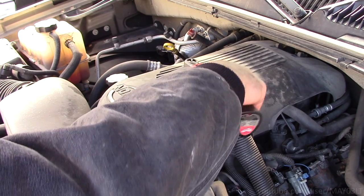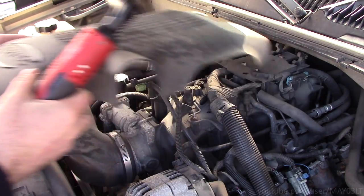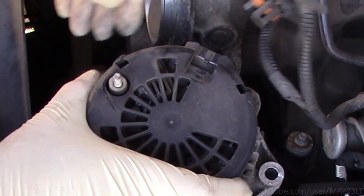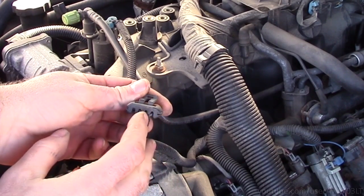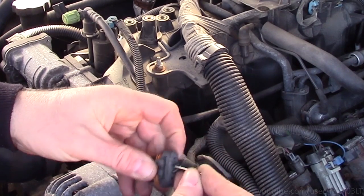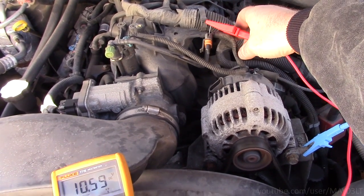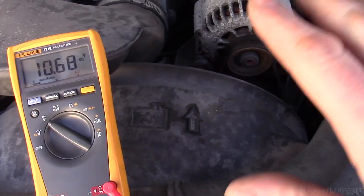I'm going to pop this engine cover off — it's just got one 8 millimeter bolt holding it on. Now I'm showing you the connector for the alternator. You don't have to have the alternator out to do this, but you just got to pull this little clip up here and the connector will slide right out. Inside that 4-pin connector, you want the second one from the end — it's a brown wire. That's the one the PCM uses to turn on the alternator. I'm going to use a T-pin and go back behind the connector into the cavity where the brown wire is, clip the red lead from the meter there with the truck running. I've got the meter grounded to the alternator case — I'm at 10.6 volts, and that tells me the computer is trying to turn the alternator on.